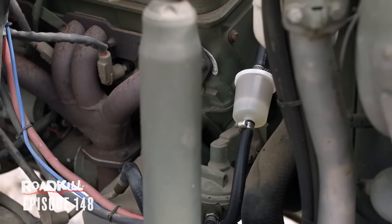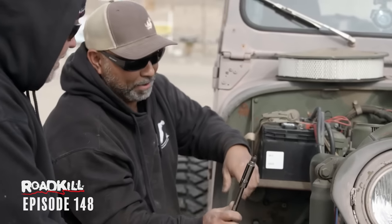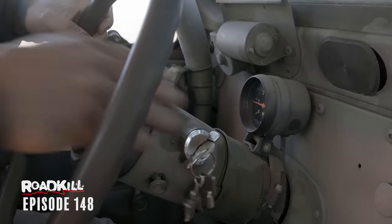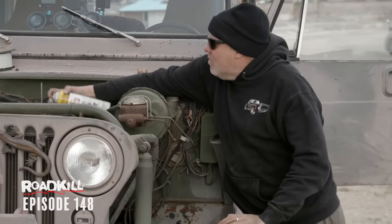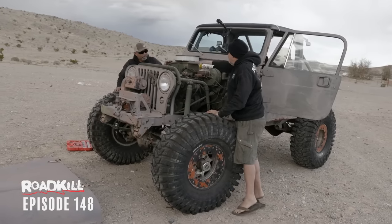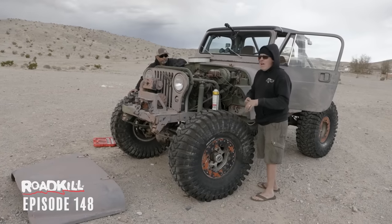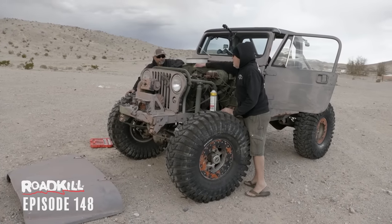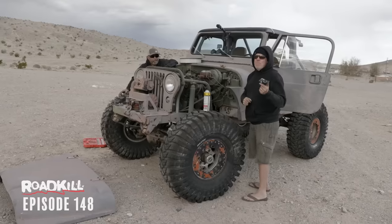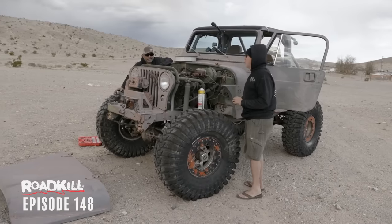We've checked the filters. Now we're going to go straight into changing and checking a plug. That ain't bad. I'm going to look for vacuum leaks by spraying carb cleaner all around the base to see if we can hear the tone of the engine change once it's sucking in the carb cleaner and combusting it. And then when that doesn't work, I'm gonna do the old man trick — the rev and suck. What I'm gonna do is pick up the RPM and then clog the primary here with my hand. That increases the airspeed through all the little passages in there and sometimes clears up an idle circuit and makes it run right. It's starting to rain.